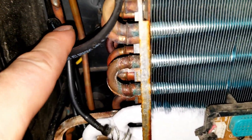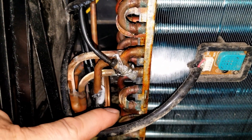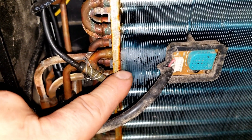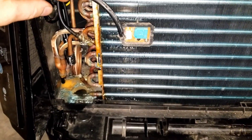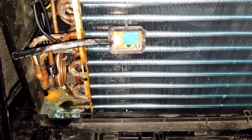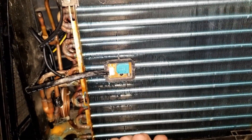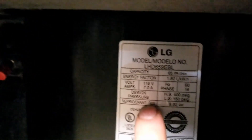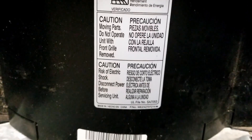This thing has been running for 10 minutes and it just finally shut the machine off. We can see the ice block is melting — that is not enough performance to fill the bucket with water and properly dehumidify a basement. As Mongo suspected, just not enough refrigerant left in that machine to perform well. This is a very old machine because it still says it's using R22 refrigerant, and they haven't used that refrigerant in machines in a long time. No manufacturer date is visible on here.